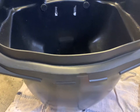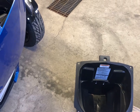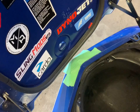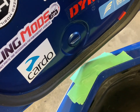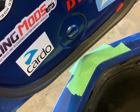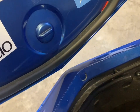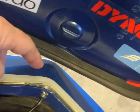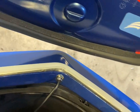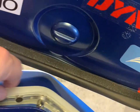We don't need to worry about the storage bin because if you look, it already has a cutout in the front. The older models did not, but 2017 and above does. The area is taped up to protect the finish. The hole is drilled, and I'm going to test fit the light. I've fed the wire in through this direction where it will connect to the power controller — it just slides right in like that.